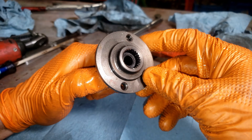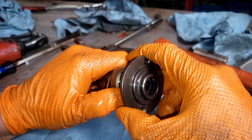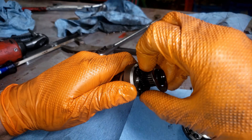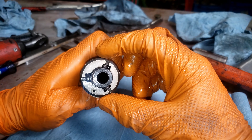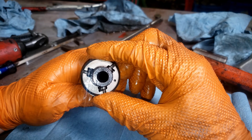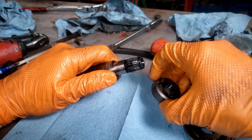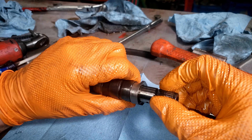The sprocket flange is a press fit on the cam and it is keyed, as you can see right up top here. So make sure you put that back on right. Beneath it you'll find a washer. And then there's a good look at the sprag clutch — it has these spring-loaded rollers, so it can spin counterclockwise but cannot spin clockwise. Pulling that off, that's the secondary decompression, which rides on this surface right here and looks in good shape.